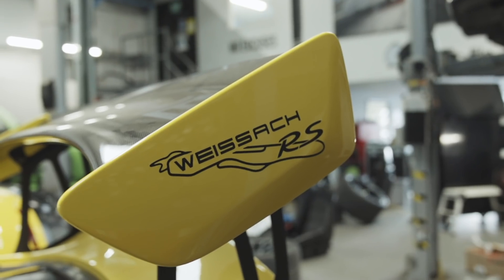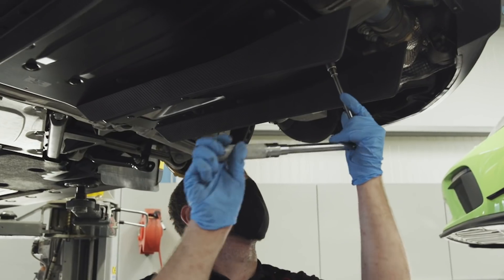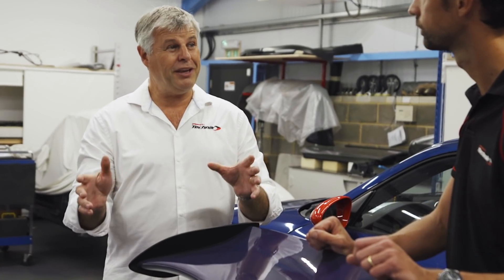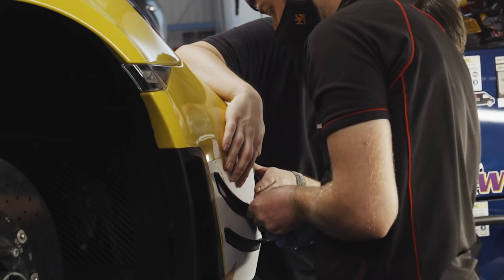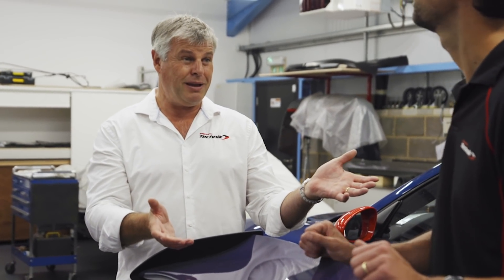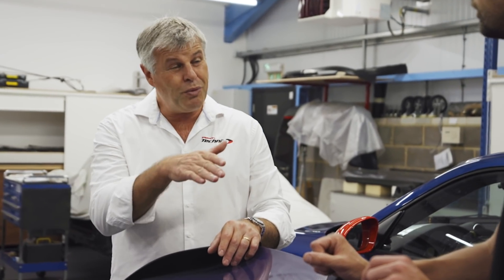You can't see it and you can't touch it, but aerodynamics is always your friend — especially once you get over 100 miles an hour. The aero works both over and underneath the car, reducing lift, so diffusers and air directors at the front can make a huge difference to overall downforce. If you put the big spoiler on and did nothing else, the car would understeer and wouldn't turn around the corner effectively at high speed. Silverstone Grand Prix circuit is a great example — particularly the Maggots, Becketts, Chapel, Hanger straight sequence of corners, right-left-right-left, all taken over that magic 100 mph. It affects braking, acceleration, transition, and change of direction — downforce is needed everywhere, and if you're racing a Carrera Cup car through there you want your wing on maximum angle.